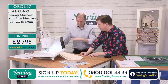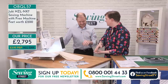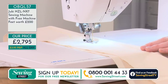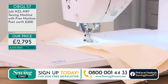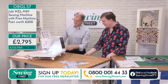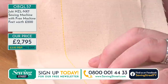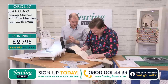You can adjust the foot lift height — for bindings and thick parts of a quilt, you can adjust it accordingly and tailor-make it. Notice every time I stop, the foot lifted automatically. And with the start/stop button, I can then just press the button at the end: it comes down, stops, cuts, lifts — and there you have one stitch seam. Look at the stitching — oh, that's so beautiful. Also, there are no vibrations — full metal chassis in the machine. Even though it's big, it's a very solid machine.